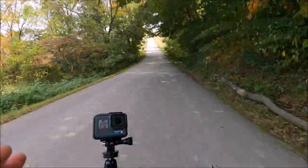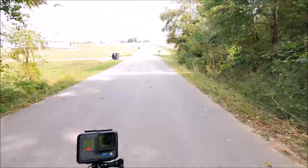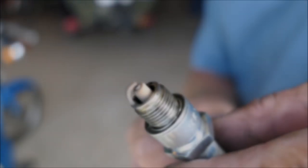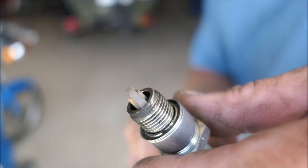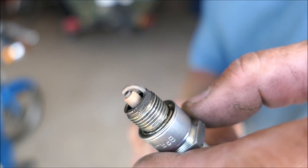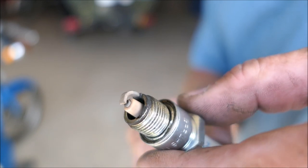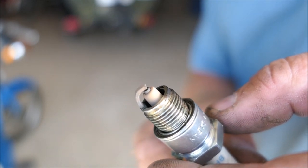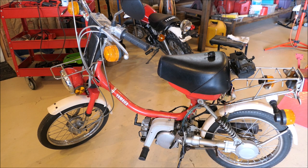One other thing I'll do before I shut this show down — we'll look at the spark plug together and see what you think. Here's our plug after that rip. If it were a four-stroke I'd say it's absolutely perfect, but being a two-stroke I'd like to see it a little bit darker. So I'm going to put my heat gauge on the head to make sure it's not overheating. If you're a ped lover then stay tuned and subscribe because this QT50 is going to be my next project — they are my all-time favorite motor peds. As always, thanks for allowing me to invade your space — I am the one and only infamous Kentucky Yankee. We'll see you next time.